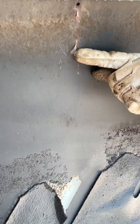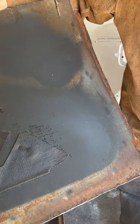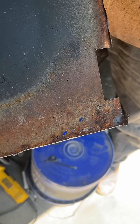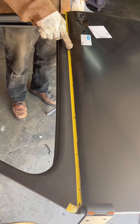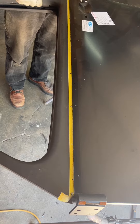As you can see too, it also has had some body work before — this is old filler. As you can see on the inside of the door as well, how bad it really is rusted. If you tried to fix that, you'd probably have issues later on. This replacement skin that we bought — what we'll do is we'll probably flange this piece here, so it'll tuck up under the original.